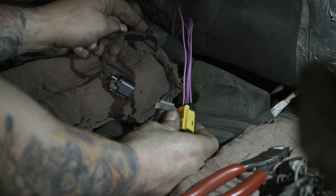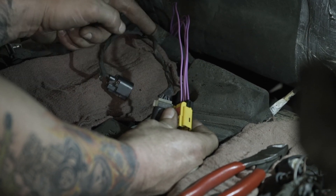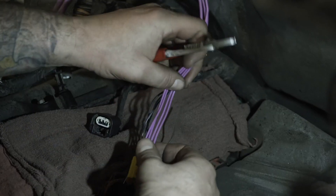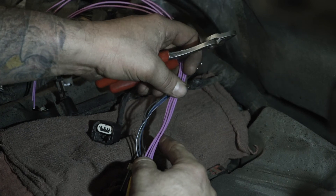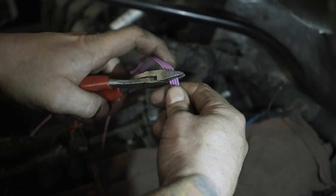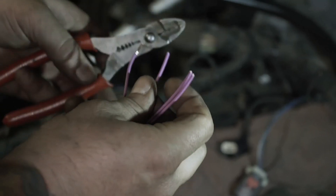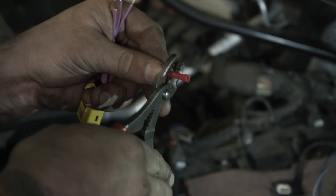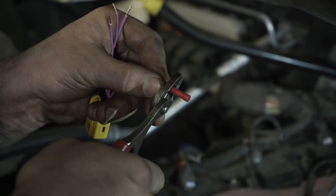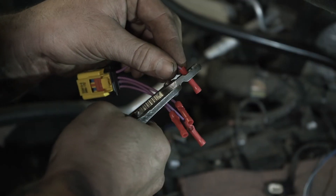You'll want to make sure that when you trim the original harness, you do so at a point that eliminates all damage when the new harness is installed. Line up the new pigtail with the original to determine how long to trim the new harness, adding another half inch or so of length for additional slack. Strip back the insulation on the new wiring to allow enough length to attach a butt connector. Pre-install and securely crimp the butt connectors onto the wires in the new harness, giving them a slight tug to ensure they're snug.